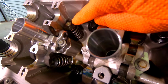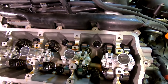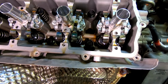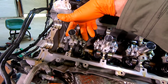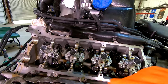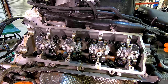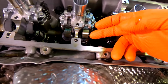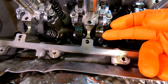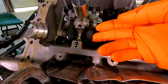We've got our cam follower fingers with the shims correctly placed underneath. We're about to reinstall the intake camshaft on the top and the exhaust camshaft on the bottom. We're going to torque everything per the book to 10 Newton meters. That's what these two were, and so are the camshafts. Once they're in, there is very much a correct torque sequence. You must follow it, or you can do damage to the camshaft. So we'll be doing that as well. Interesting to see a little bit of the wear difference on the existing followers versus the brand new followers.